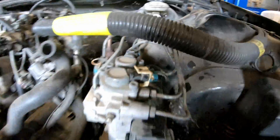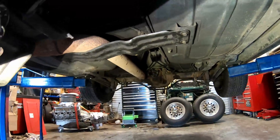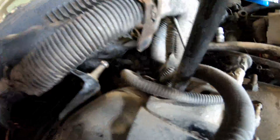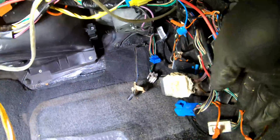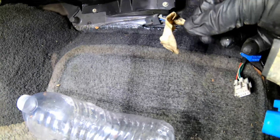Pulled the brake booster hose. Pulled the brake lines to the front brakes. Unbolted the sway bar. Removed the slave cylinder. Removed the torque arm, the cross member, and the drive shaft. I removed the ECM and disconnected the four plugs that go to it. Pulled these two plugs in front of the ECU. Pulled the vacuum hose that goes to the heater controls. Down there are four plugs that need to come through the hole in the firewall — remove the plastic panel under the dash. You have these three and one that goes to the evaporator, and they all slide out the hole in the firewall.